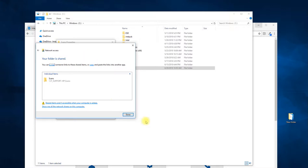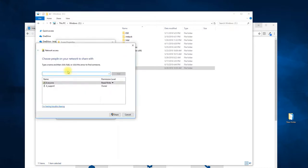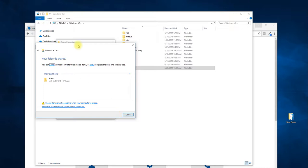Now, if this folder is a secured folder and you did not want to open it up to the Everyone group — if you have a specific user ID created that the MFP is going to use — you can add that specific user as opposed to a group. The Everyone group opens up the folder and allows everyone access. If you just want the MFP scanning to the folder, put in that specific user and give that user read-write access. Once the folder is shared out, you'll see the confirmation window. Everything looks good, go ahead and click Done.